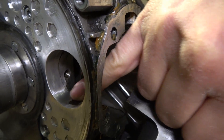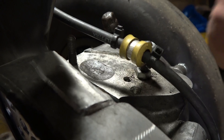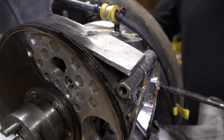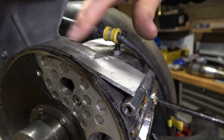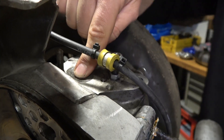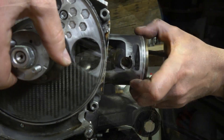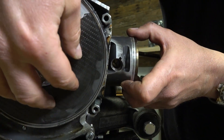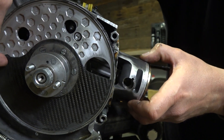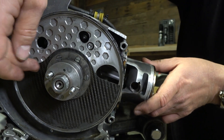I need just some two-component stuff to close this gap, and the same on the top. I bought an old casing that was already broken, and sealed it with two-component filler. The gap between the outer and inner casing is about 1.2 millimeters, and this one is about 1 millimeter.